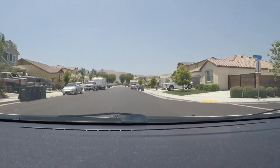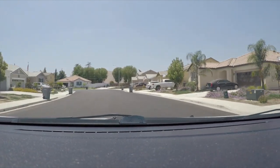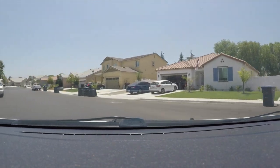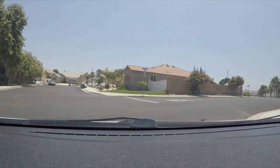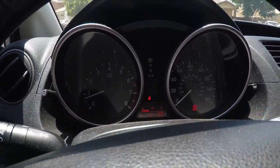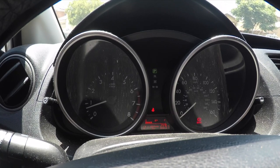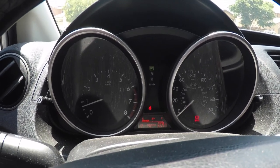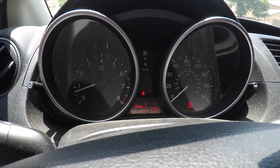I'll also do it the old school way — turn the heater on high and drive around with the windows down to see if the fluid level drops more. Round four got interrupted by a DoorDash delivery, so I skipped it. I drove around the block with the heater on high and fan on high, and ran an errand. Then I drove a good distance without the heater, and it started to get hot so I turned on the air conditioning.